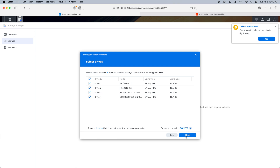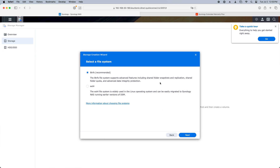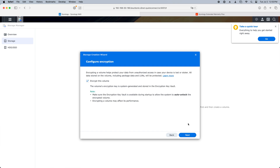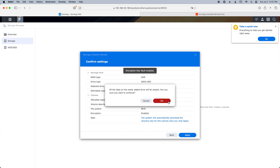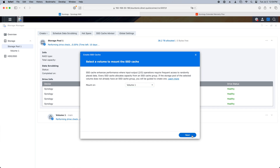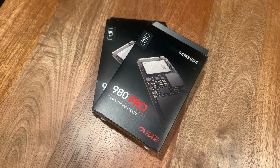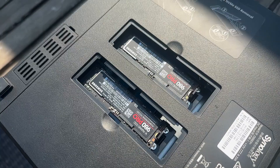Back to the installation. At this point, the OS will complain about not using an official SSD, but I'm pretty sure the Samsung 980 Pro is more than sufficiently reliable. The configurator will give you a pick of file systems, but BTRFS is really the way to go because of its fault tolerance. You can choose to encrypt or not, and I went with encryption. After generating the encryption key, I can now format my drives. Now that the storage pool is ready, it's time to configure the SSD for cache. First format it, and then create an SSD cache. This caught me off guard because you need two SSDs for read and write caching — this is the only thing in this entire process that annoyed me, because it's a bit overkill. To get the full benefits of an SSD, I ended up buying a second 2-terabyte SSD for read and write cache. Synology requires a RAID 1 array for SSD caching.